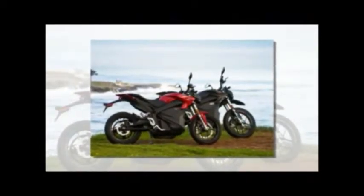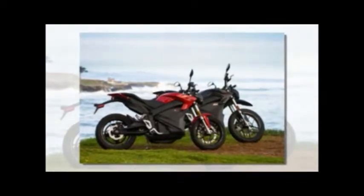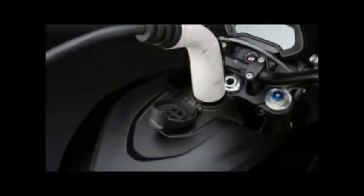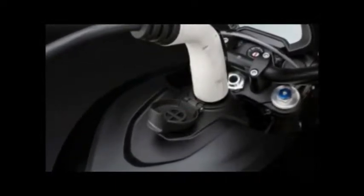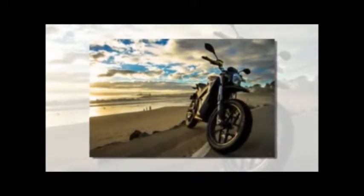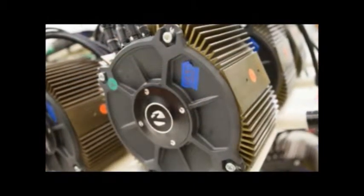It produces less overall heat compared to the SMPM, and the metal rotor the magnets live inside acts as a heatsink to absorb the remaining heat still produced. Plus, the rotor is a petal shape instead of being perfectly round, providing a slight cooling effect as it spins. Ultimately, says Askenazi, this new motor gained 45 Celsius, 113 Fahrenheit, of thermal capability, which now takes it into a motor that doesn't run into its thermal limitations on the street.